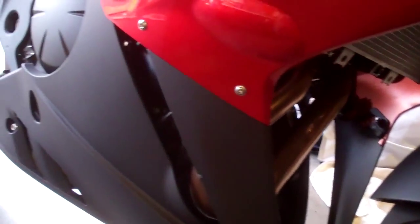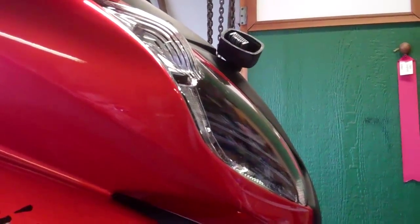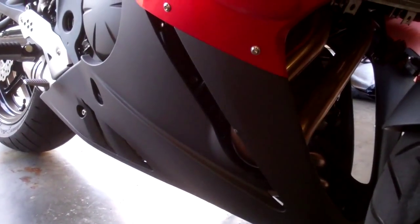The next piece to take off will be the lower fairing, which is the black one down at the bottom. You may be wondering why we have to take this off to install a headlight. The reason is because it's connected to the piece which the headlight is in, and it's easier to remove the upper fairing if this is already detached. Taking this off makes it a whole lot easier to get in there to actually install everything.